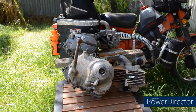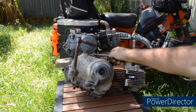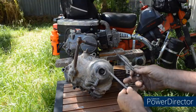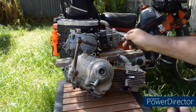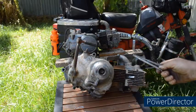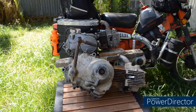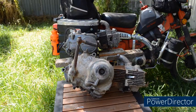And what are the differences? Well, firstly, the mounting bolts. On the Honda they're M10, and on the Li-Fan they're M8, so they're much smaller. So the top mount on the Li-Fan needs to be drilled out to accommodate the 10mm mounting of the Honda. Also, the shape of the engine is different, and the location of the rear mount is in a different place.